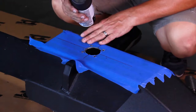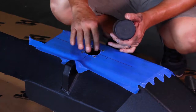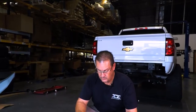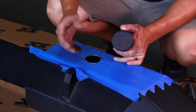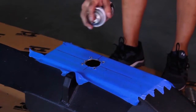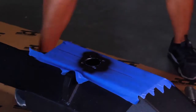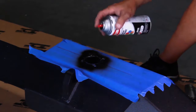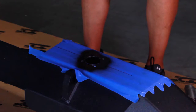Last thing I'm going to do before I remove any masking tape is shoot a little bit of satin black spray paint on there — just some Krylon satin black. I'm going to hit these areas that we just opened up and removed powder coat from. If you don't coat these areas, you will get rust over time. So anything we've exposed to bare metal, we need to put some sort of protectant back on it and seal that surface back up. We want to paint these areas before removing the masking tape so we're hitting those areas only. I'll also flip the bumper over and hit the inside surface as well, so both sides are completely coated and there's no chance of rust.